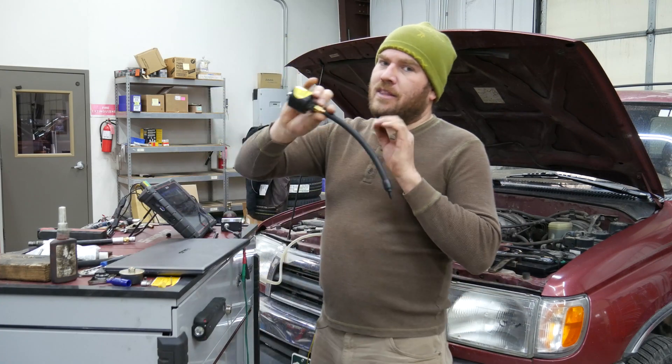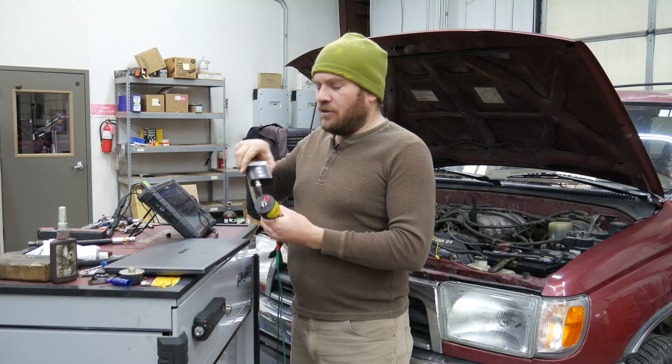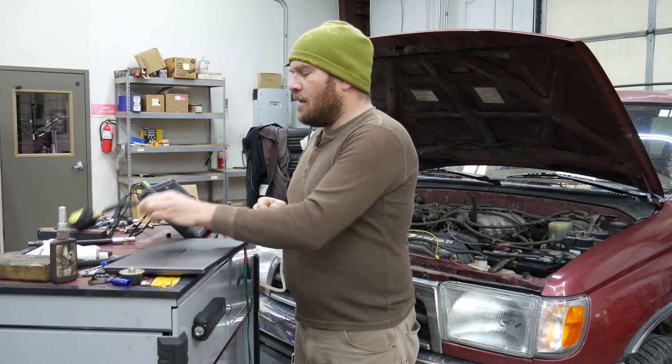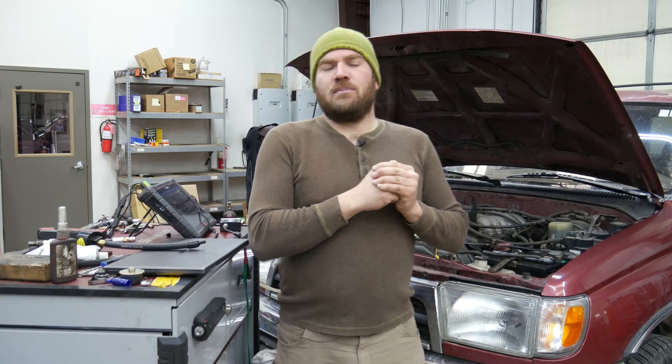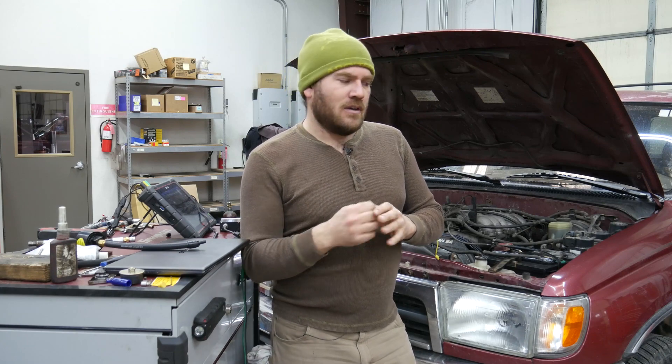We are still using the pulse sensor and the pressure transducer. I'm going to stick with the WPS500 since I still have it out from the previous test, and I'm still going to use the Nicholson pulse sensor. This test is going to be a cooling system pulse test with the sync and possibly relative compression. We are suspecting a bad head gasket on this vehicle, and we want to confirm that we have some pulses going on in the radiator.